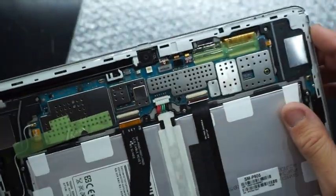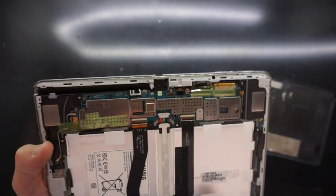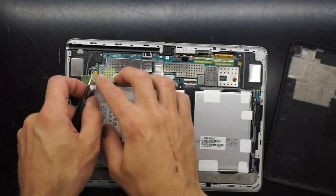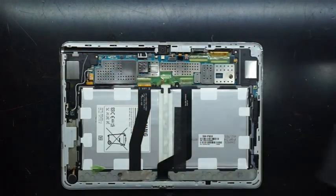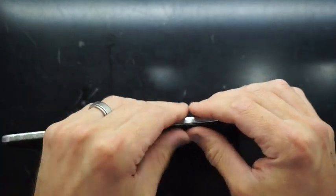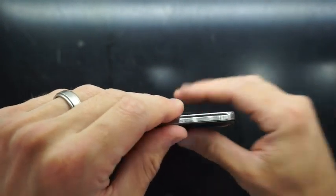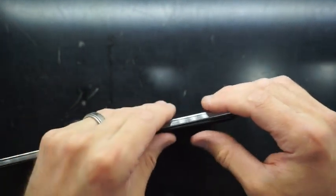I did try and start it up right now but it's currently dead flat, so that doesn't help in the way of testing. I've just had it on a bit of power — it did give it some juice and it was displaying for me. So I'm going to finish up the install, put the tape back over the battery connector and the flex connector. The back cover is relatively simple to push on — all you need to do is clamp it with your fingers and massage it around, and you should feel it click into place as you work your way around it. And that's really all there is to fixing the SM-P605 non-backlit issue.